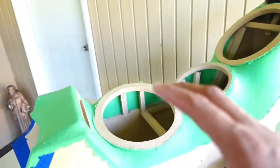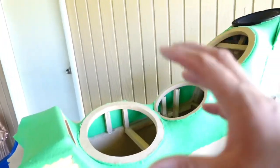On all the panels in my truck, I used these products along with the gel coat paint that Yellowfin uses on their boats. We use those on our panels, and they're made to outlast this heat. You see what I'm saying? This paint and fiberglass material is made to be in the sun. They probably experiment with this stuff so much so it's the best product they can put on their boats, so they can charge what they charge for those boats. The gel coat paint can stand in the sun forever, and the resin's never gonna crack underneath. And that's what you want. You don't wanna use other stuff where eventually one day you may have an issue. Not saying that stuff's not gonna chip or break if it's treated in a bad manner, but holding up in the sun, that stuff is never gonna mess up if you do it right.